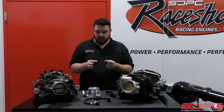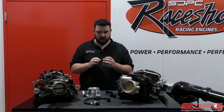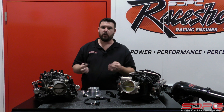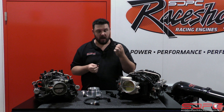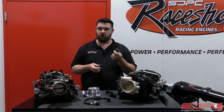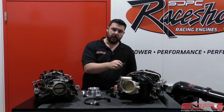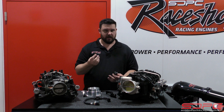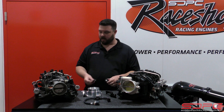A lot of guys see these and say, well, they're both three-pin electrical connectors — can I not just buy the connector pigtail and adapt it onto my harness? You can, but then you have to adjust the scaling in the tune. These sensors read differently, so if you do that, make sure you and your tuner are well aware of it so they can adjust accordingly. Most guys adapt the old one to the new intake and have a lot better success. That would be our recommendation there — and it also saves you money in case yours didn't come with a MAP sensor.